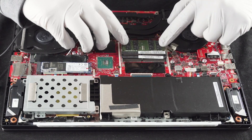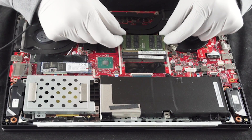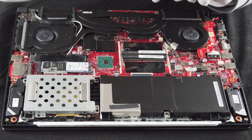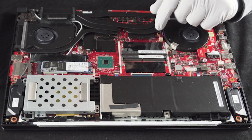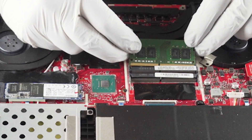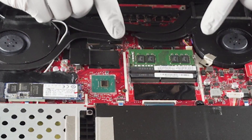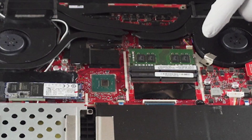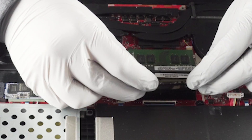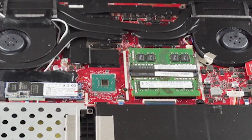It's just going to be these two little metal tabs — I'm just going to pull them out. The stick pops up to a 30-degree angle and comes right out. There should be no resistance; if there is, you're probably doing something wrong. To install new memory, it goes in at that same 30-degree angle and you just push it down until it clips — it should always fully clip. We're going to do the same for the second stick: 30-degree angle, and it clips right in.